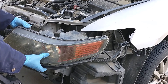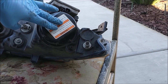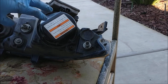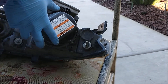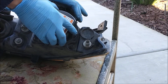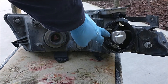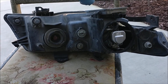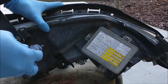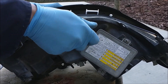Take out the whole headlight. To replace the igniter, which is inside, you may need to remove a screw if it's broken. Turn the collar — you may need two hands because it's tight. Take it down and you'll see the igniter inside. After removing the cap you can see the igniter. Next, remove the ballast, which is held by three screws — remove the screws with a Phillips screwdriver.